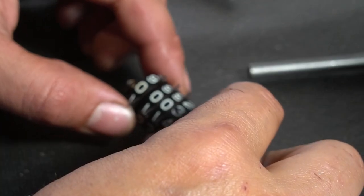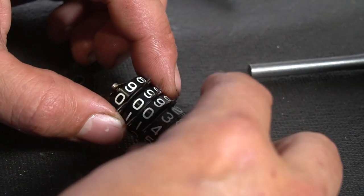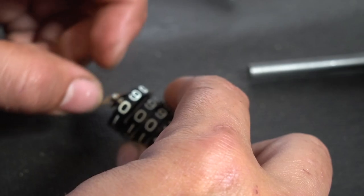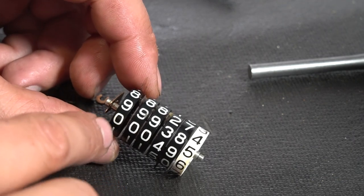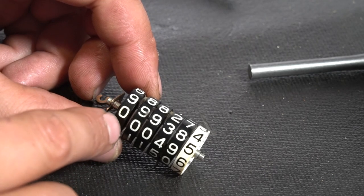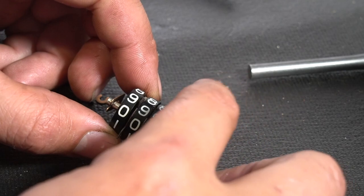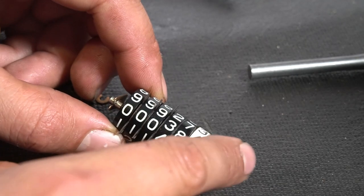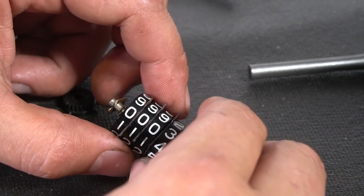Now we have some room to pull these dials, these face dials, apart. There's like a little planetary gear setup inside of here. So we've got to pull them apart so that we can rotate these face dials to zero across the board. And then it allows you to also make the adjustment where you have these little locating thin brackets, I guess you'd say, that help keep it in location when it's remounted in the chassis of the odometer body. So we're going to rotate, pull them apart, make sure you get the little retaining clips, or these metal things, in the middle of the zero area, and then do that for every one of these face dials.